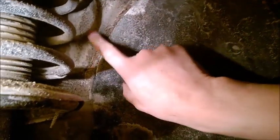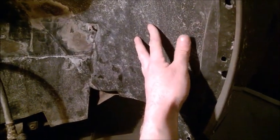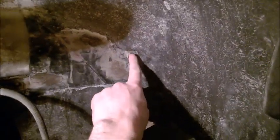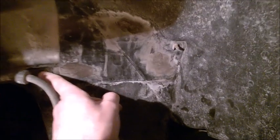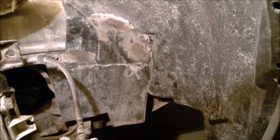Get the plastic close to the frame here, then push on this side — that's the front of the car. Push with force like this to really bring the plastic close to the frame. That's the problem; it's so hard sometimes to really reach those studs to get them back into their plastic hole inside. So that's just a tip, because if you don't go the proper way, you are going to fight with this for quite a while.